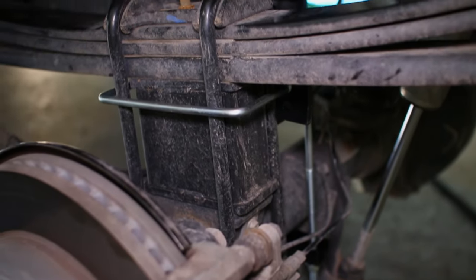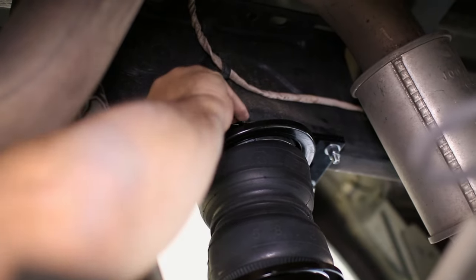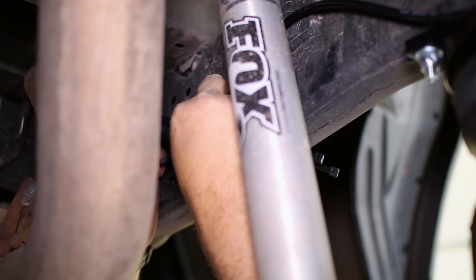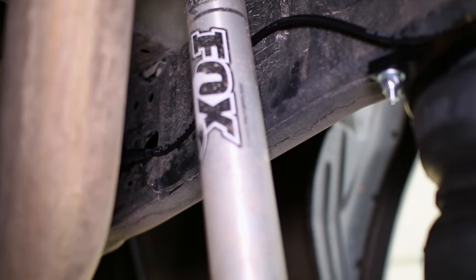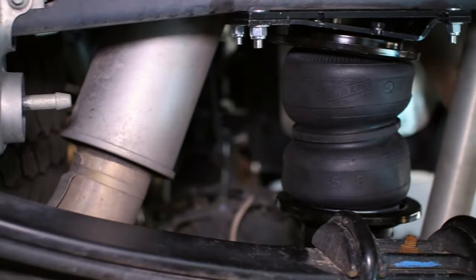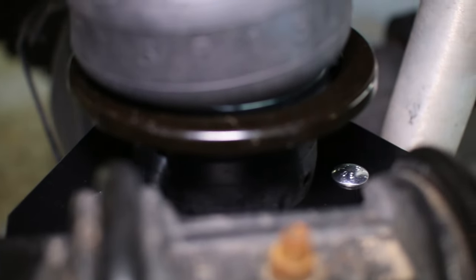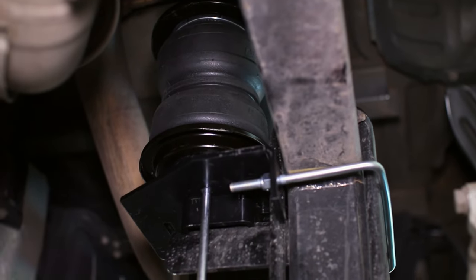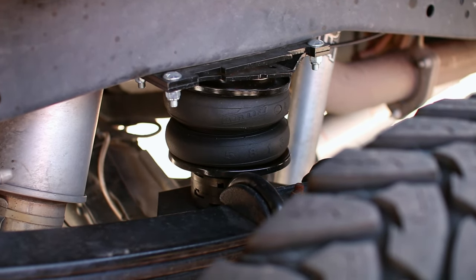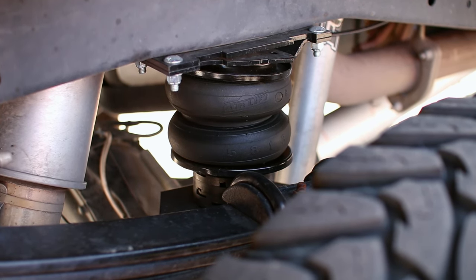Here is the final shot of the airbag assembly on our Super Duty. Depending on the kit you purchased, you will either have a manual airline attachment or an onboard compressor. We installed the compressor with our setup, but if you decided to install manual airlines, all that is left is to cut and install them to the bags and mount your air valve where you like. Air Lift designed this rear air spring kit to support your existing suspension system and accommodate seriously heavy duty loads. The air springs effectively improve ride quality and towing capacity, reduce wear on your tires and suspension, and the Load Lifter 5000 air springs provide up to 5,000 pounds of leveling capacity for your heaviest loads.